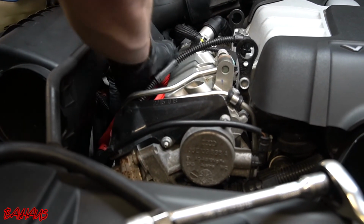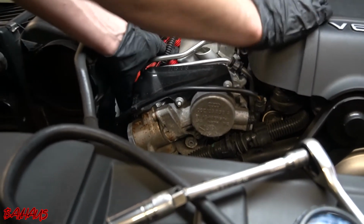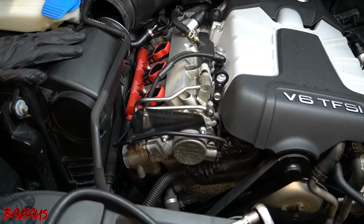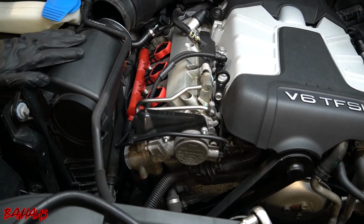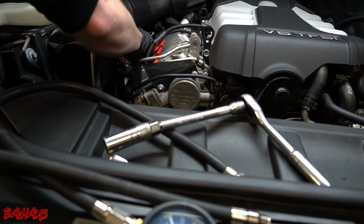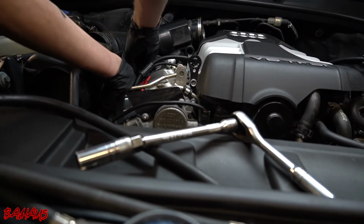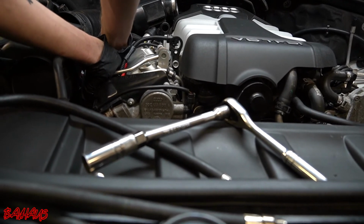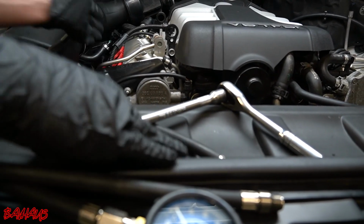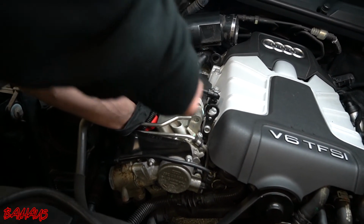And the next thing we're going to do is remove the supercharger and pull the cylinder 2 injector and the cylinder 1 injector and swap them and see if we can get that misfire cylinder 2 code to follow. If it ends up on cylinder 1 when we reassemble, then we know that the injector is the issue. If it doesn't, then we know we have something else going on, and we'll continue to further diag by either doing a cylinder leakage test, start looking into things with the borescope. There's plenty of things that we can continue doing. So we're just going to continue filming on this thing until we got the problem solved.